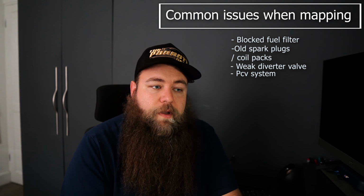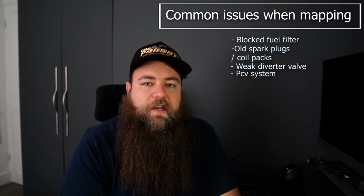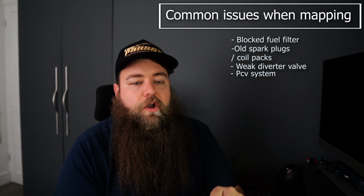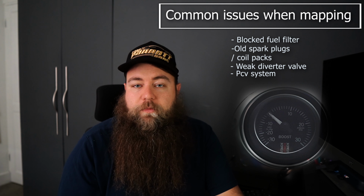You just don't know. If you have a turbo car, definitely recommend getting a boost gauge, because that is the easiest way to know if you have a problem. If you have a boost gauge, you're out for a drive, you look, and you've only got 5 psi, you know you've got a problem, because you're meant to have 10 or 12 or 15, whatever you're meant to have. It's nice to have it visibly obvious on there. Plus, it's quite cool looking. Easy enough to run most of the time. So that's kind of the common issues which will be caused when mapping.